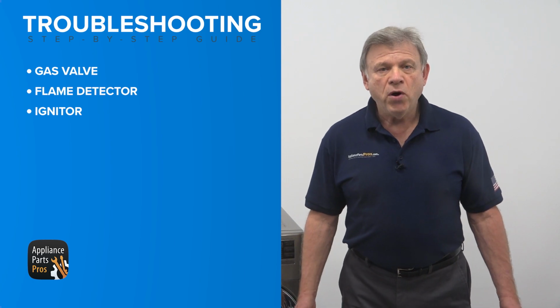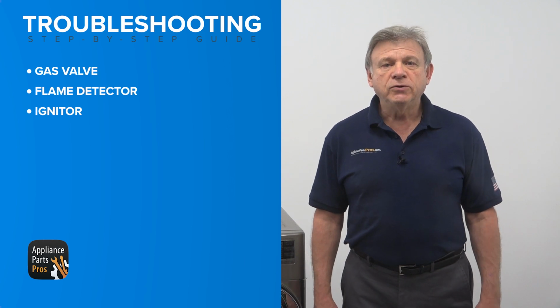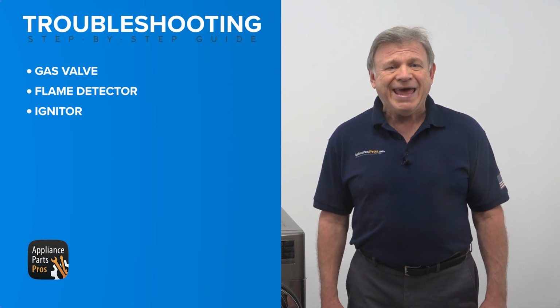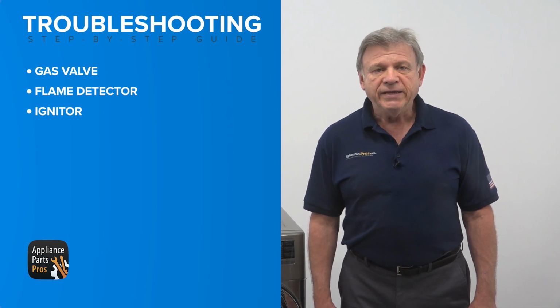When electricity is going through the igniter, it gets really hot and ignites gas inside the burner funnel. Igniter could go bad in 2 ways: burn out completely and not produce any heat, or lose its resistance and not be able to open the gas valve and ignite gas right away and hold the flame torch long enough.